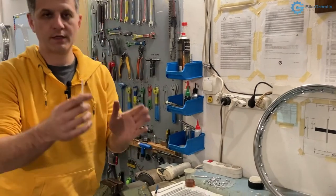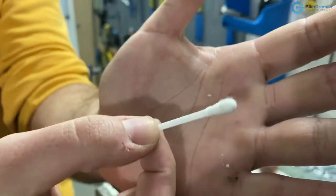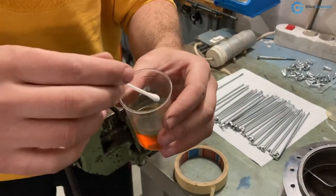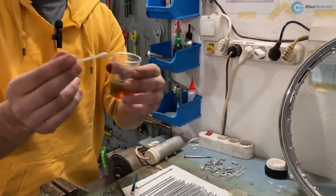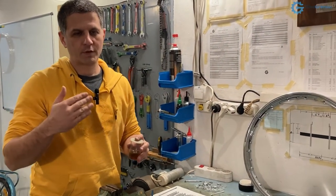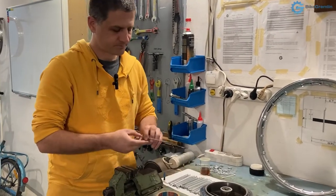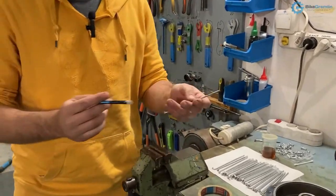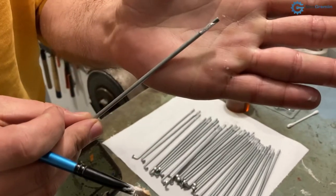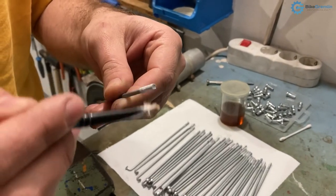An alternative way to prepare the rim is to use something like a cotton swab — sold in supermarkets — dip it into some oil, whichever oil you have, and use it as a brush. That also works great, but anti-seize provides longer anti-seize protection, so I prefer it especially on motorcycle wheels. Then come the spokes. For spokes the principle is the same — I use a brush with some anti-seize and make sure all the threads are coated.